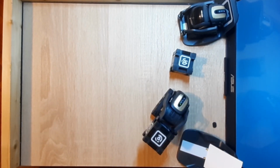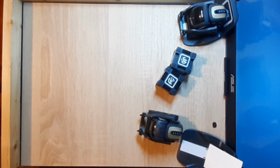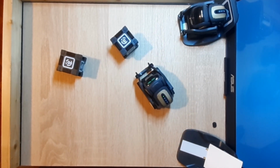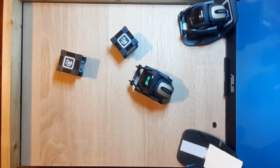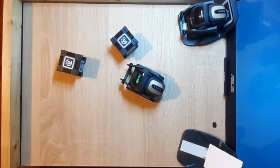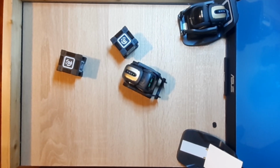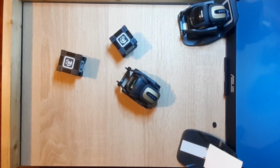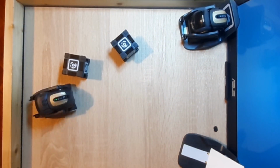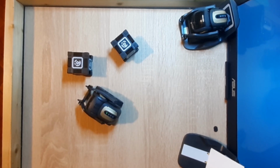In short, the bot will get hotter and will opt to perform less power-consuming tasks in order to prevent overheating, or will even show warnings of being close to overheating and eventually go to sleep. So the batteries that I purchased are indeed of higher capacity, rated at either 450 or 500 milliamps, and you'll see in the video why I say this or that. It's quite funny. That is around 30 to 40% more than the original battery. However, these batteries are thinner than the original one but longer.